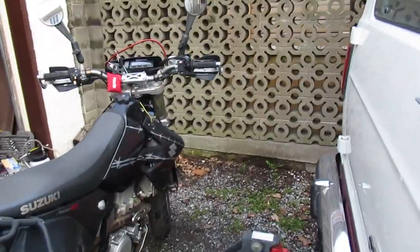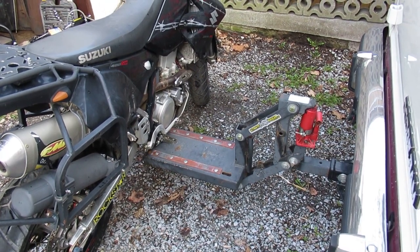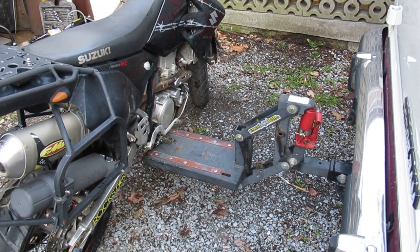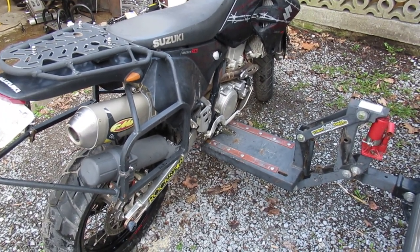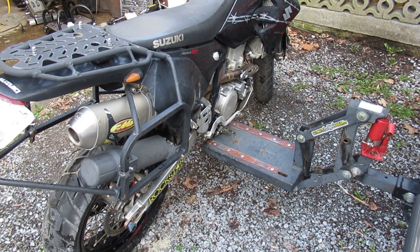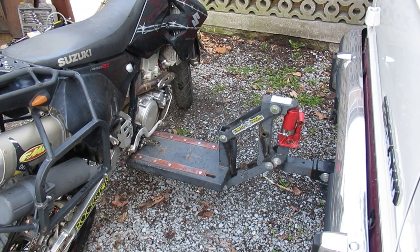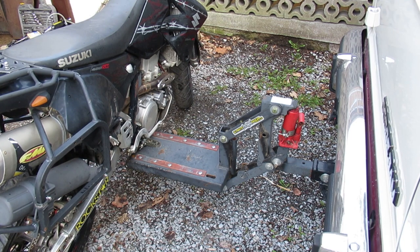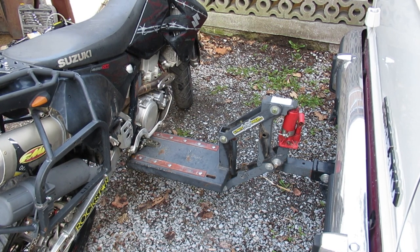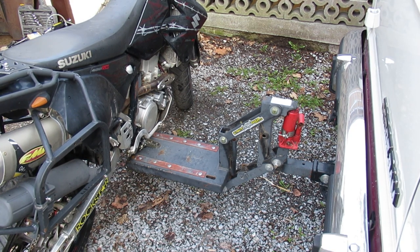So right now the skid plate is like the perfect height for this combination of a vehicle, Ultimate MX hauler. When I've got my off-road wheels, it's easier to lift. But when I've got this on the back of my Jeep, it has a 2-inch lift. I can't use it just standard way with the SM tires. It works with the off-road tires really well. So that's why I bought the 10-inch drop. But what I didn't take into consideration was how much droop my Jeep suspension had. So it drooped too much when I have the 10-inch drop on there.